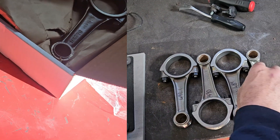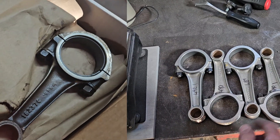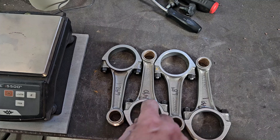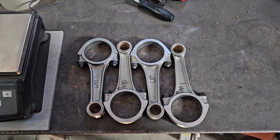These are ready to get lubricated with some oil to stop them rusting, because we've cleaned them, vapor blasted them and ceramic polished them. Bushings are all honed and sized, big ends are all checked, everything is balanced and ready to go back to its owner.